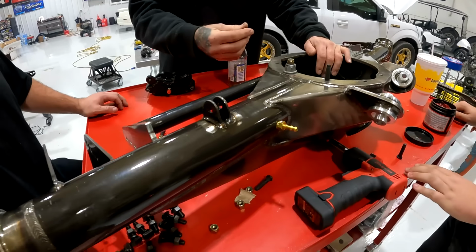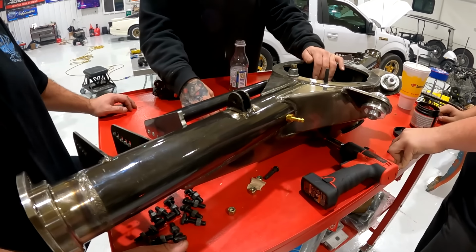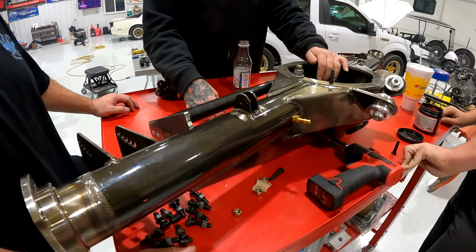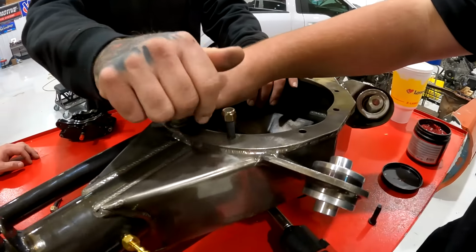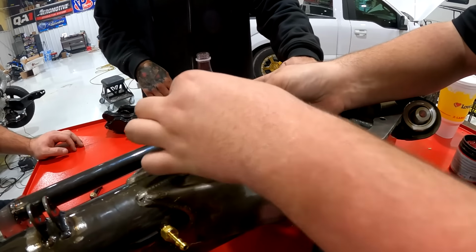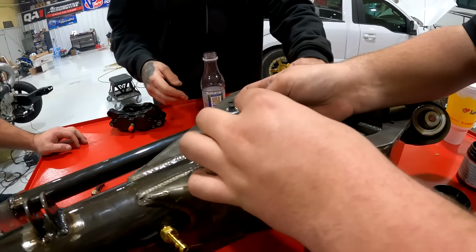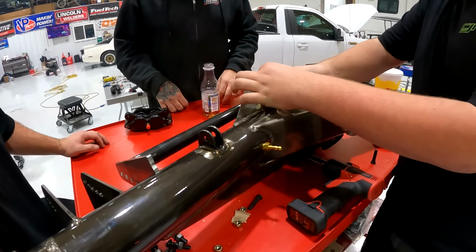Try to use a different nut every time. I got this nut right here. Or use a different one every time, because eventually you'll wear that out and tear the threads out of that nut. In fact, that's what I would do. The one that you use this one for, I'd put back on that just like that, and then use a different one every time. Because one time ain't gonna hurt that nut. 15 times might. 15 times gets excessive.